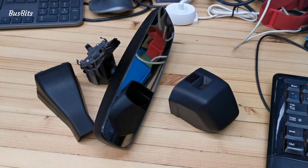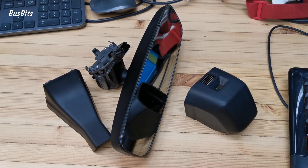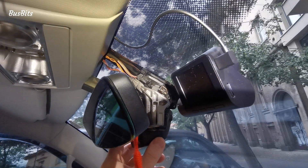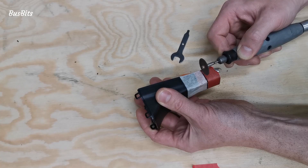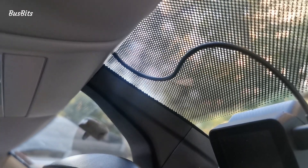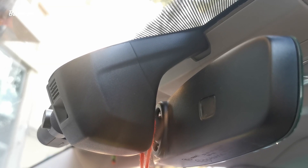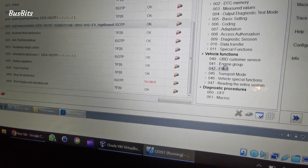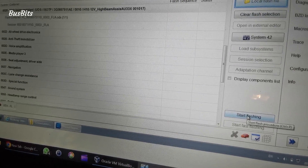Now I will cover the MQB mirrors. T6s are built on the PQ25 platform which does not share many vehicles. On the other side the MQB platform has many car models and even brands, so it's much easier to find a nice mirror at a decent price. My rimless mirror is from an MQB Golf 7. As you can see the wire harness cover from Golf is a bit too long - the correct length is 85mm, you can see the difference in shape and length. After a bit of trimming it will fit just fine. As mentioned, the MQB mirrors cannot be used out of the box. You will need to connect Odis to your car using the grey adapter VAS 5054A shown earlier to reflash the mirror with the PQ25 software. Here I'm showing the process of reflashing which is pretty straightforward. I will leave a link in the description with all the details on how to do it.